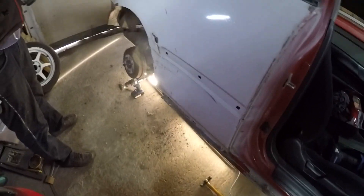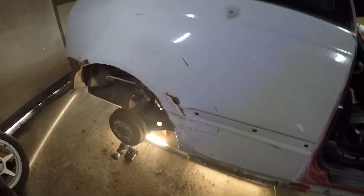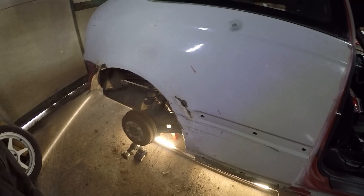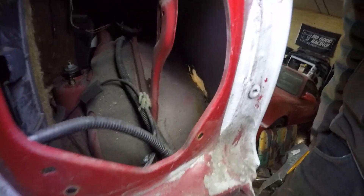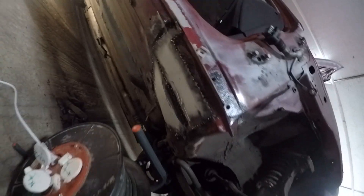We need to figure out what we can use, because this car had - if you shine a light in here - you can see the wheel well is just all rusty and shitty. So we'll probably have to make a strip to make a new wheel well and then put the new panel in. The front is sort of done - just needs to be seam sealed. The welds aren't the best and I need to do the middle here.